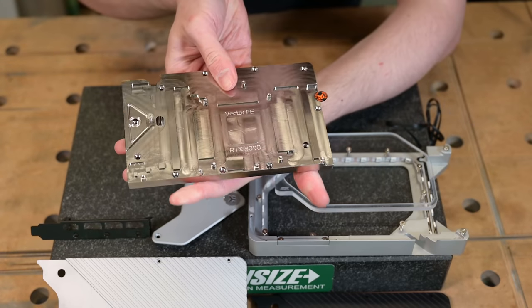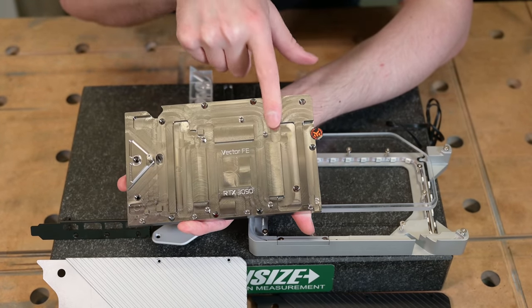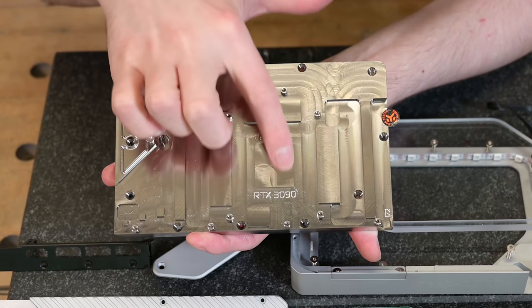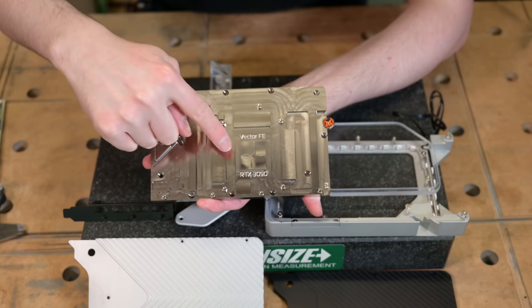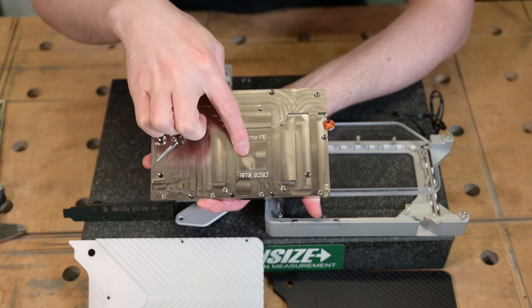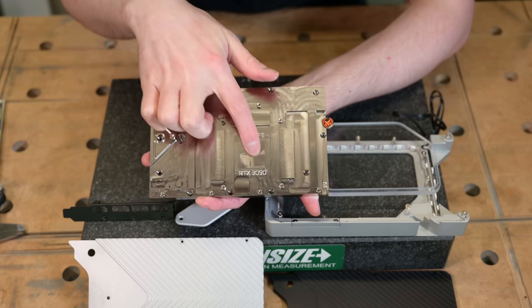On the other side, there are some interesting decisions here. So obviously we've got ourselves a trochoidal toolpath here, very efficient, sort of what you'd normally expect to see. I'm not so impressed by this. So rather than going over with a tool using, say, a parallel toolpath, they've just used a sort of pocket one over here. I don't really like that because you can see that's quite a large sort of spiral we got here, and I can actually feel that with my finger.